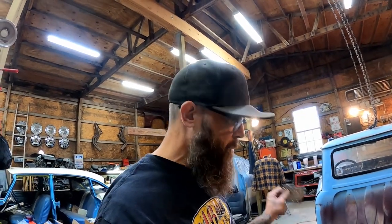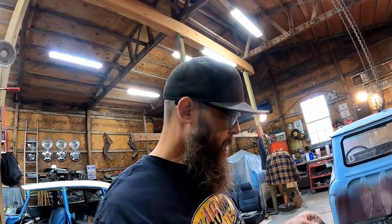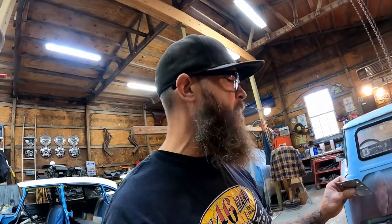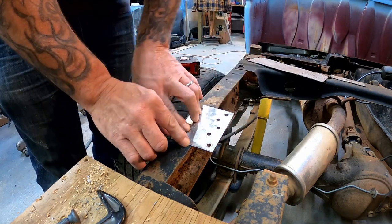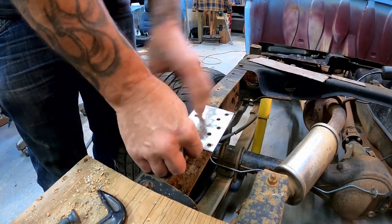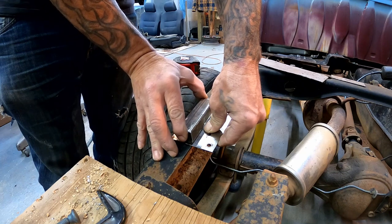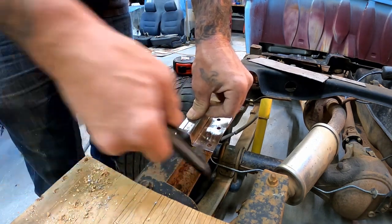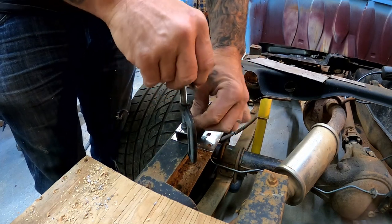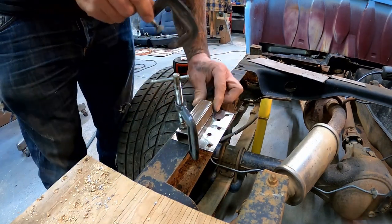You could do this at home, so simple without any fancy tools. I believe this is 16-gauge, plenty thick enough — it's actually way thicker than the factory sheet metal, so it ought to be very strong when we're done and still easy enough to bend. I'm just going to use the frame of this truck and basically bend this right down the middle. I'll line up the edge of the frame right where I want my bend to be, put a little piece of metal on top of it, and sandwich the two between a C-clamp.